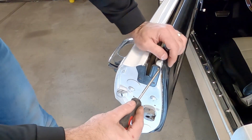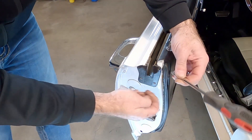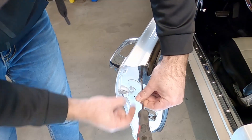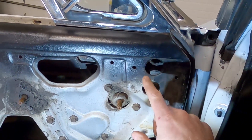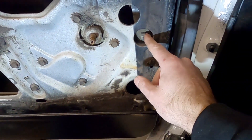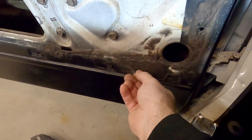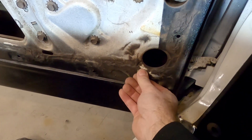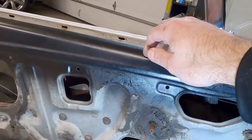Next, take off the weather stripping cap rubber piece off the end of the door because it'll be slightly in the way when we pull the window out. Then we want to loosen the four bolts holding the vent window to the door — just loosen them, don't remove yet, because it makes it easier to get the window out. These are all half-inch: there's a bolt here, a bolt there, and a nut. One of mine is covered with some material but behind it is the other fastener.